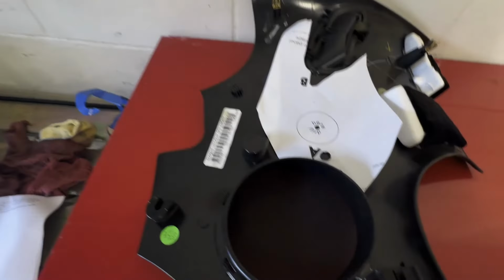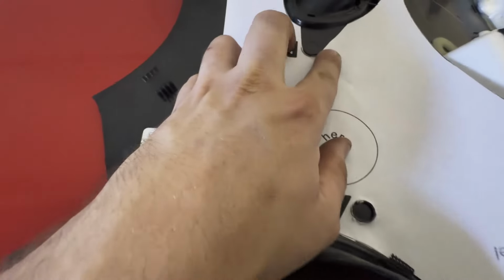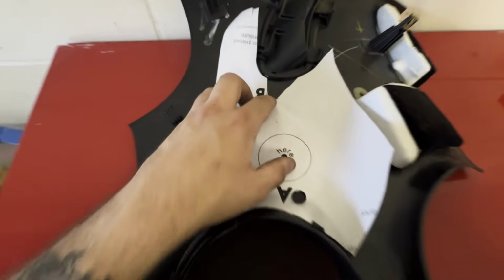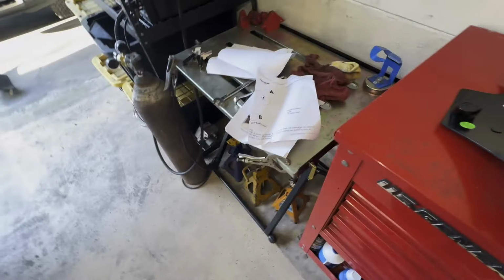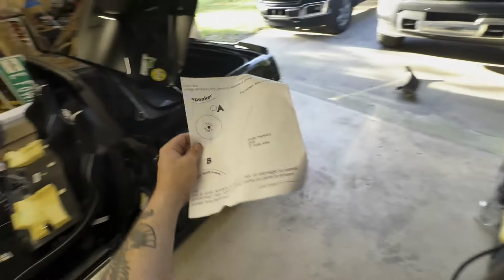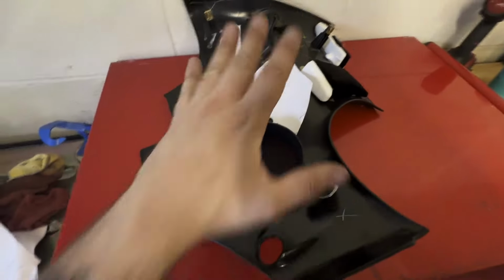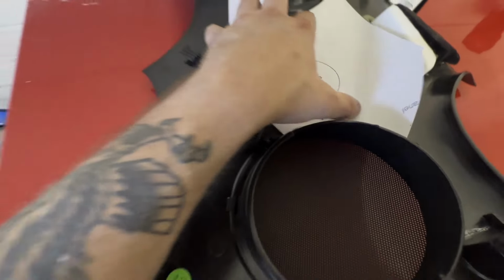These right here are really going to drive the majority of the fitment. So you can see there's a little lip right here, and this is on the back side of these panels now. Like I said, make sure that you're using the proper one. You know, this is passenger. It's going to go on the passenger one back there. And then this is driver side. If you get this wrong, you're probably going to have a really bad time.